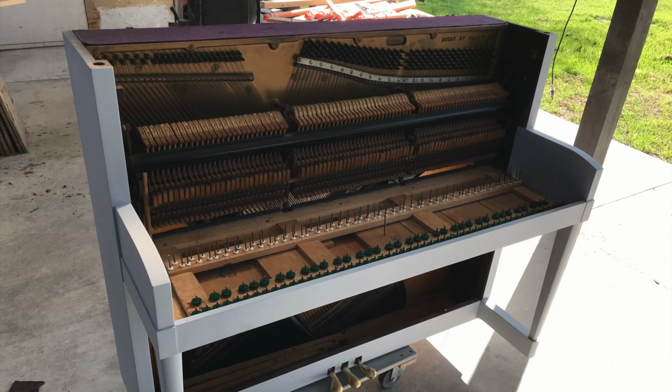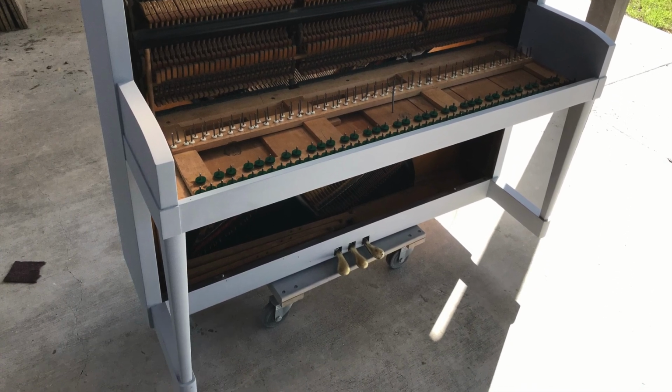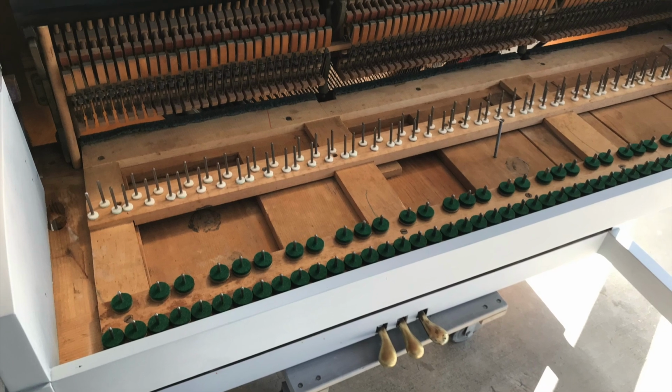The other thing that goes along with that is typically you're going to tape a little differently than how you would if you'd prime. When it comes to painting, I might be running my tape lines a little further in so that some overspray can blow in certain places. Or maybe I taped for primer on purpose a certain way so that I could cut an edge. The primer tape lines are very thick, so you'll do it right on an edge where you can sand that down easily, and then I might be painting to the next surface over. So I basically take all the tape and paper off as soon as the primer's done, and it's all sanded down. Then I do that final tape and prep before getting the color on.